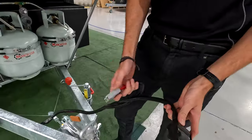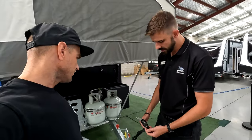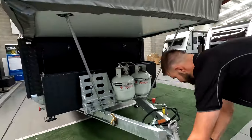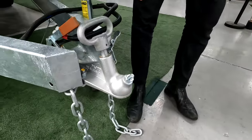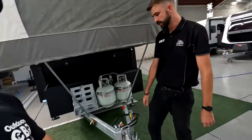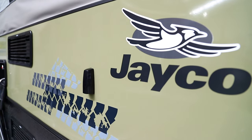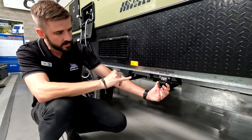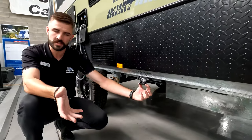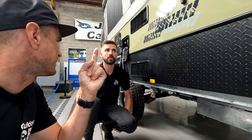In the drawbar, electrically they now come with a 12-pin plug and an Anderson connector going directly to the fridge to run it while you're driving. If you get a DC-DC charger you'll get a red Anderson. Safety chains are standard on all models. Standard tow ball, but you can get a DO35 if you want, which is more of an off-road 360-degree movement hitch. At the back there's a TV antenna port — some caravan parks give you reception to tune into their satellite. There's also a little Anderson plug for a portable solar blanket; it says unregulated because there's already a regulator inside. There are no panels on this model but you can get a 200-watt solar panel.